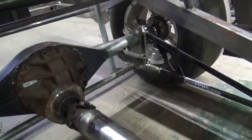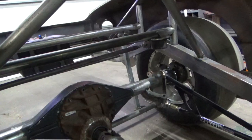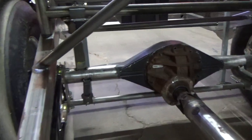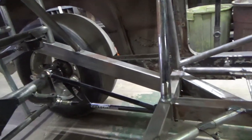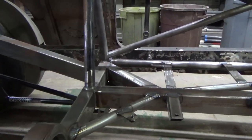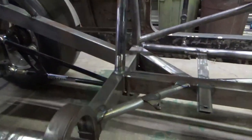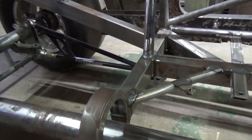That right there is the lower spring mount. In my cars, I typically use a coil spring for a couple of reasons. I've built a few leaf spring cars in my lifetime, and I've never been happy with the way they turned out, because calculating spring ratio has been a bear for me. So I've found that using a coil spring is a lot better. From my previous video, I talked about how to find approximate instant center line — basically a string from the bottom of the tire up to the front bumper — and you want that ladder bar point to intersect with that line at the middle adjustment. If you try to make the bottom bar as level as you can, it's a pretty good starting point.